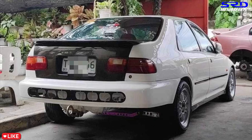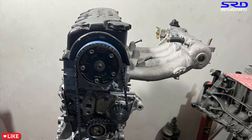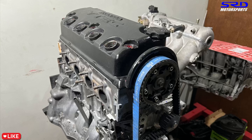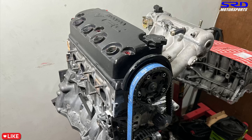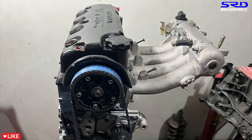There's also this autocross mini-me build — a D16A6 block with a ported P08 head and a ported Skunk2 intake manifold. The owner is now deciding on a camshaft upgrade since he's currently running a stock cam. He may order a cam through me, so we'll disassemble the top end when it arrives. It's going to be a fun autocross engine.